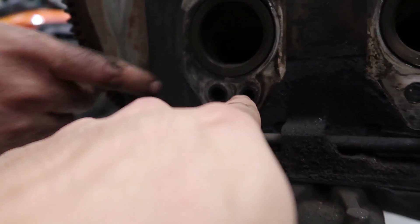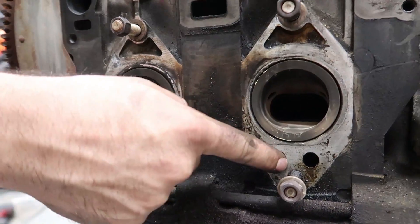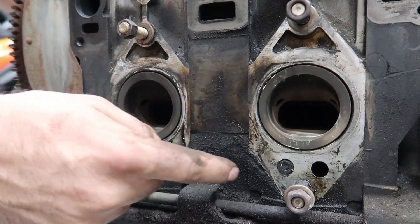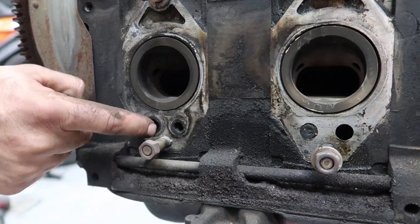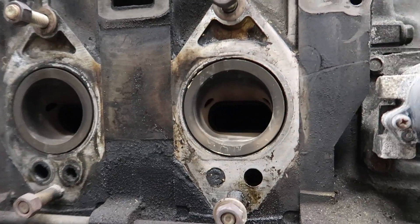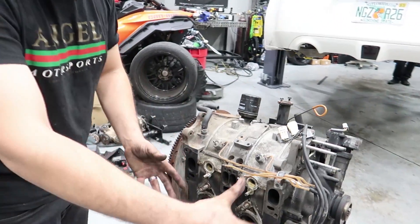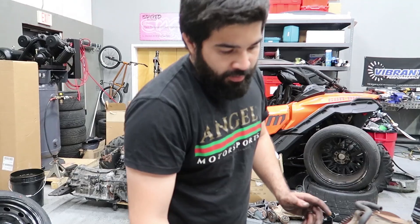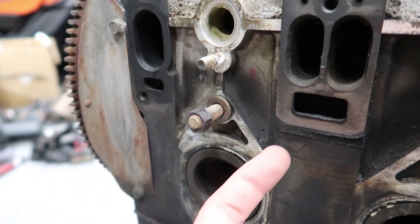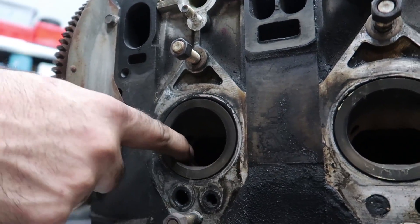There's a lot of gunk on these holes — these are EGR ports. The turbo manifold only uses one port, so it uses this one over here and this one, but Mazda only made one mold for one housing. So one port isn't used on this housing but is used on the other — it just comes up with nowhere to go, hitting a wall in the manifold. It's just EGR stuff.